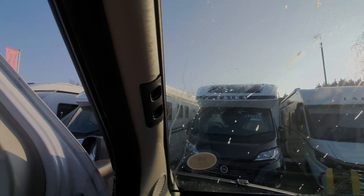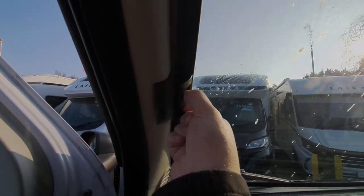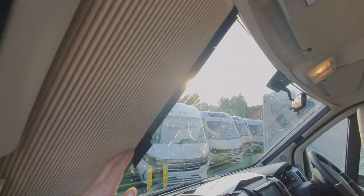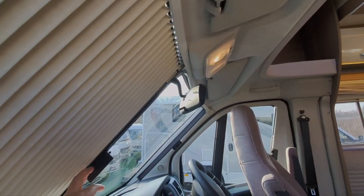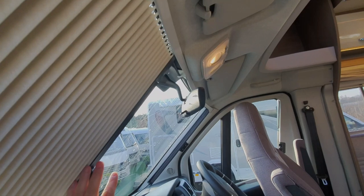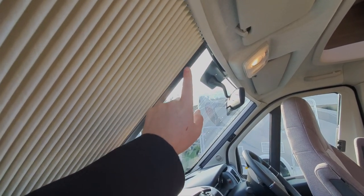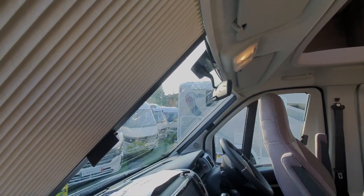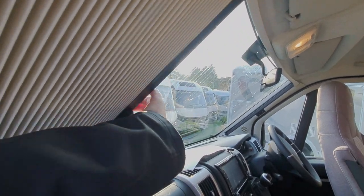As you're drawing it back again, make sure that the bar is going back straight and then just push it back into its slot, making sure that these clips are in place. Very similar thing on the windscreen blinds — you just pinch those two together, draw that across, and again this has got a magnetic strip across this side here. Draw that all the way up to the reversing mirror; there's a little slot just there that allows this bar to go past the arm on the mirror, then do exactly the same on the corresponding side and they join together with a magnetic strip.